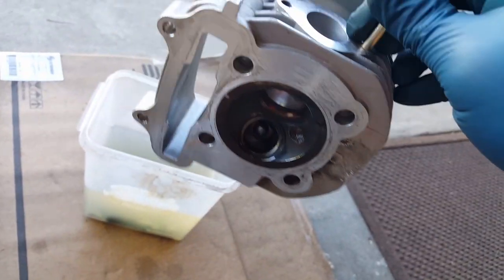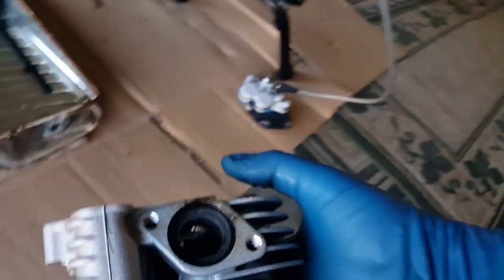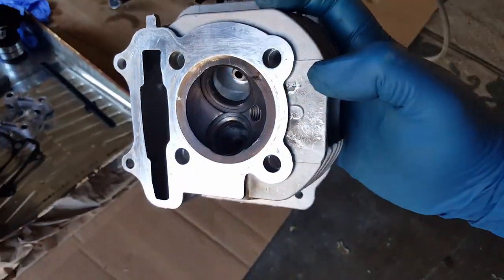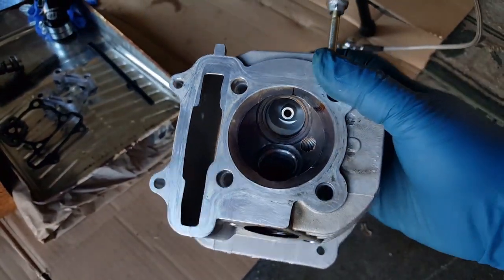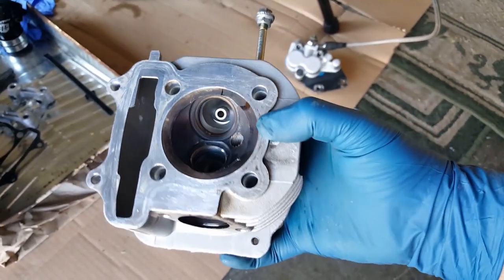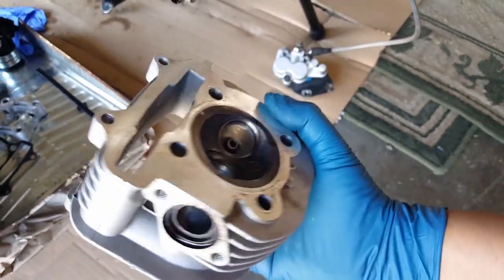I'm going to submerge this one here — I'm going to put the darkest side where the exhaust is. You can see what happened — remember the white smoke from the side? My cylinder is facing this way on the bike, and we saw the smoke come out but couldn't tell if it was from the exhaust. We had an exhaust leak a little bit, but mainly it came from right here. You can see where the blown gasket is — the gasket wasn't sealed in this area. It's a blown head gasket. Motor oil could have got in through the cam a little bit too.